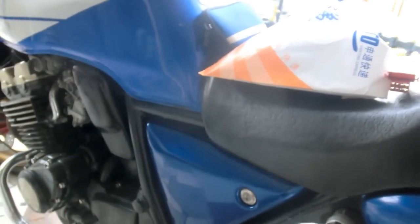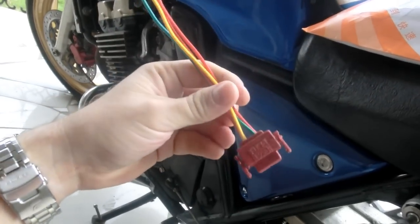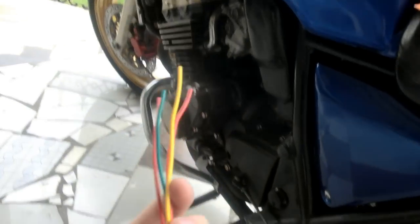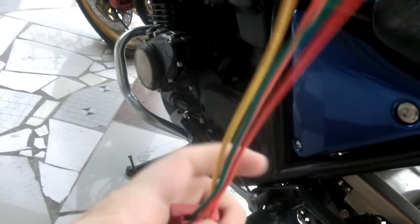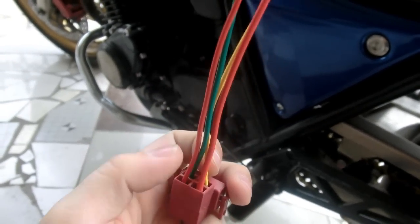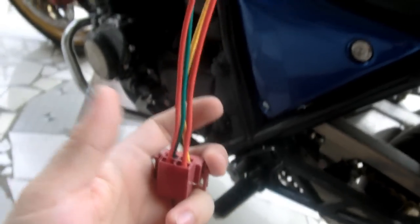Right now I've managed to sort of jury-rig it so it works, but it's not ideal. It still cuts out. If I take this thing for a power wash or something, then it doesn't want to start afterwards — stupid things like that. So I'm going to pull the other one out and show you what it's all about, then I'm going to replace it. I've also bought separately this wiring harness that connects on top of there, and I will rewire it because the old one has been exposed to a lot of heat, so all the wires have basically deteriorated.